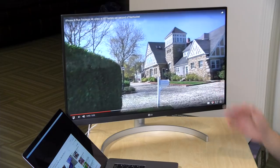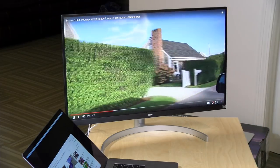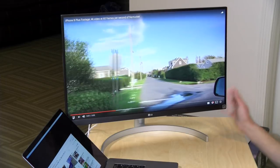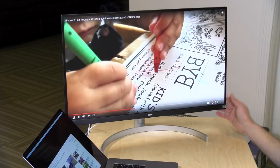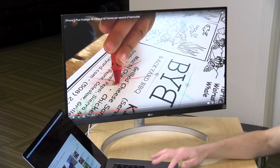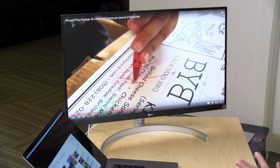Response rate on this one is 5 milliseconds, which means you won't get a lot of motion blur when you have fast motion on screen — great especially when playing back 60 frames per second content. For gamers, it supports AMD FreeSync. What we've seen from these AMD displays is they typically have a range between 40 and 60 hertz where FreeSync will be useful, and what that does is smooth out the frame rate, so even if your computer delivers a variable frame rate between 40 and 60 fps, the monitor will not tear or look jumpy. So if you have an AMD graphics processor, you should be able to see some benefit using this display.